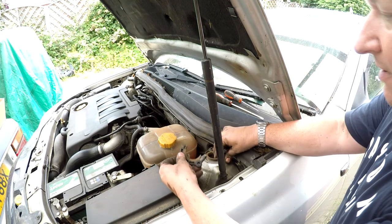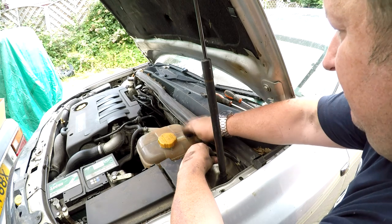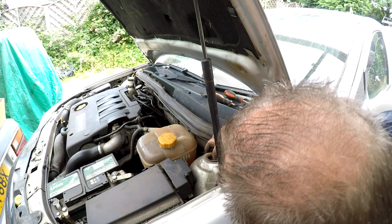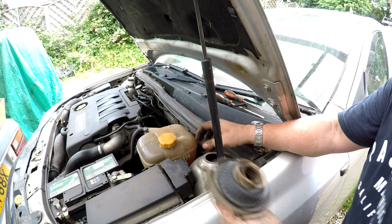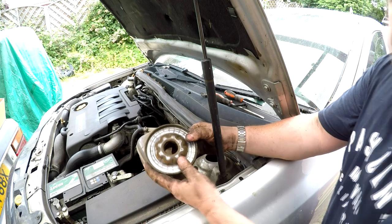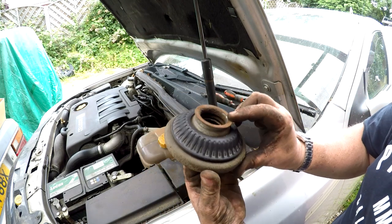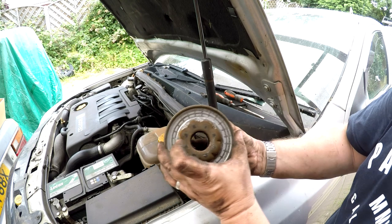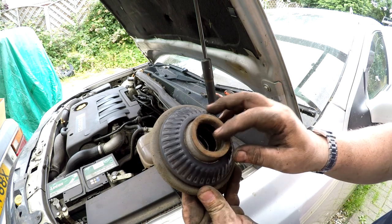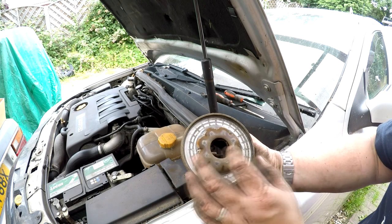Just comes apart in two halves. This should drop out the bottom - this should have been attached to the shock. Bringing this out, as you can probably see, it's this shock mount. In there where it's welded, it's actually come adrift. So what he actually needs is one of these top mounts. He could have gotten away with just a shock, but we didn't know that at the time, so he's got a new shock going in anyway.